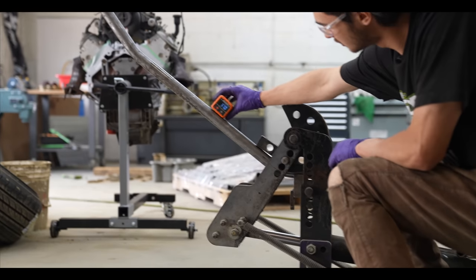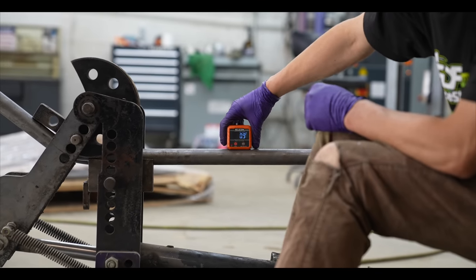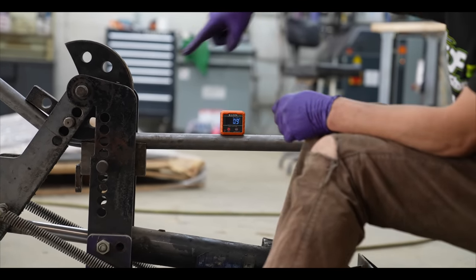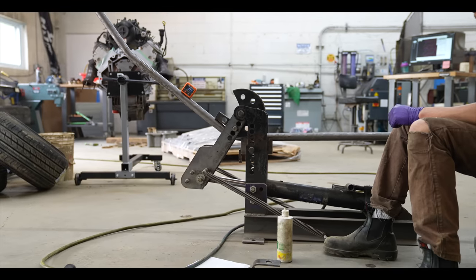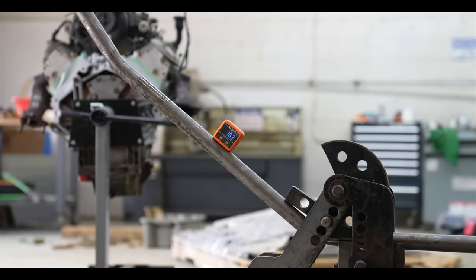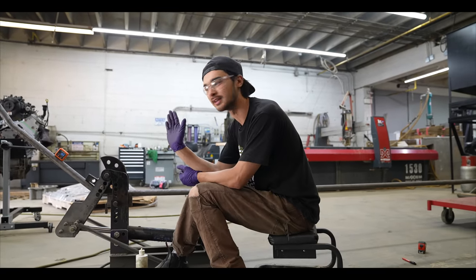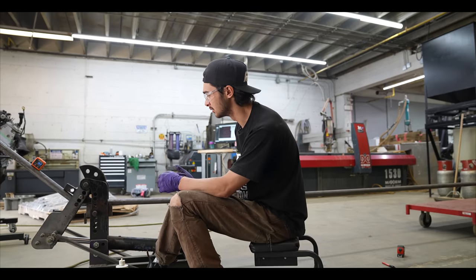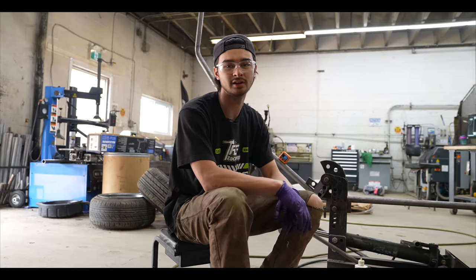Checking the base it's at one degree, and the angle reads 37.2 degrees. Nudging it about one degree brings it to 38.3 — literally perfect. Like I said, we had to bend it over a couple extra degrees to get the spring angle right, but in the end it worked out. Now I'm going to throw this in the bandsaw, chop off the end, and test fit it on the car.